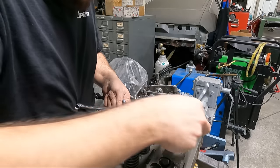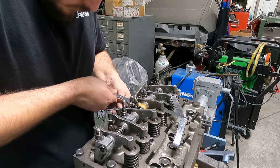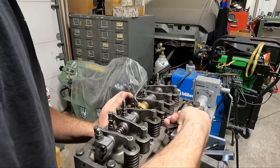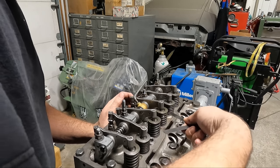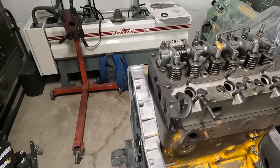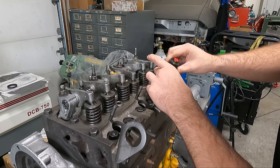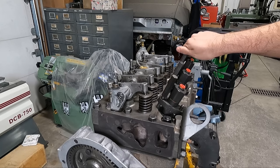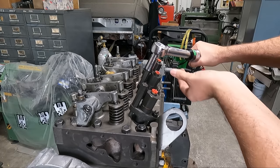With the rockers installed I moved through and set the initial cold lash spec on each of the rocker arms, which is done with an adjustment nut on the tappets themselves. Checking with our feeler gauges we set them so the proper size feeler gauge slides between the valve tip and the rocker while the next size feeler gauge will not. We ordered a set of rebuilt injectors from Spencer Diesel in Spencer, Iowa, who have always been really good to us — and no, they don't sponsor us, I just think it's really important to let other businesses know when you appreciate and trust their services.